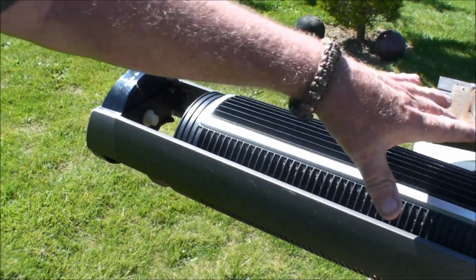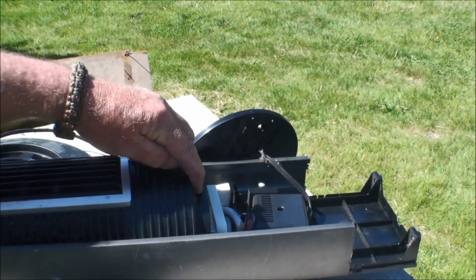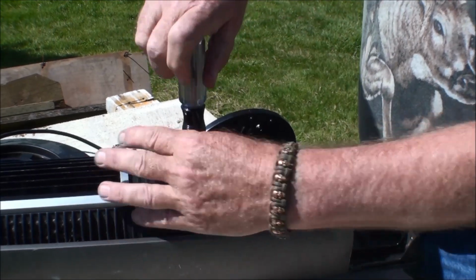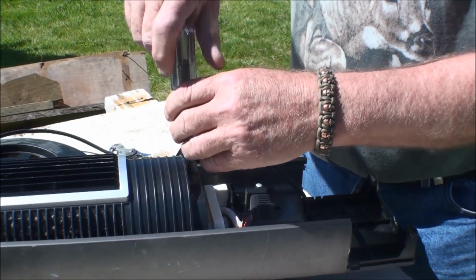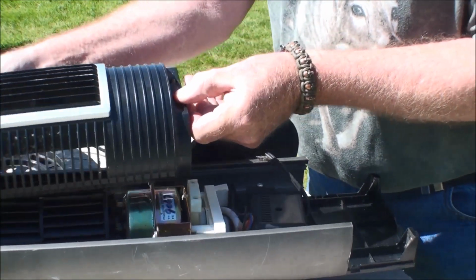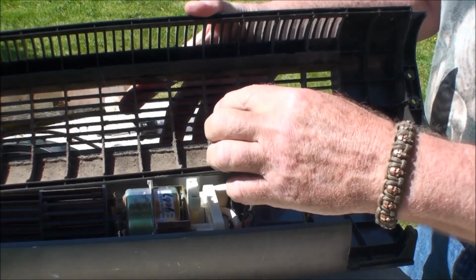Okay, I slid these metal brackets this way, and after getting so far I noticed this here is free, except down here at this end I need to undo these two screws here, and then possibly I can take it apart. And this looks like it's a Phillips, because it's in where most people wouldn't be already, I guess. This thing's really dirty. Besides, like I told you, it needs oiled bad. Get those two screws out. Gotta be careful not to lose those screws. So that's all we need to do. Now, obviously, now we can clean this filth in here.